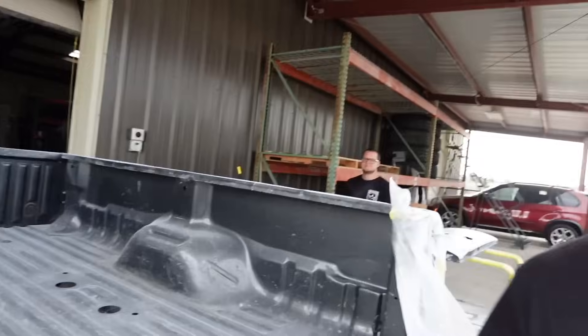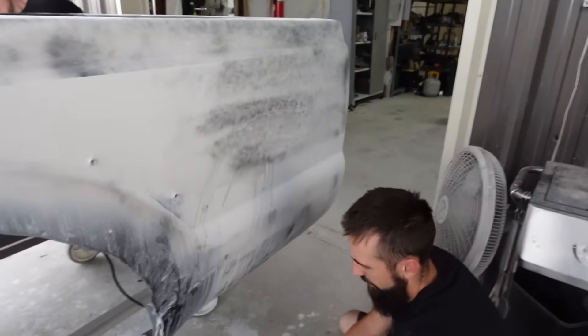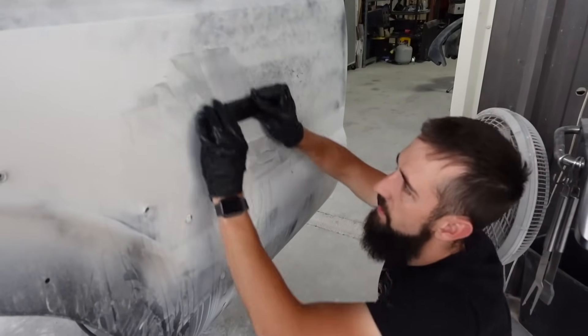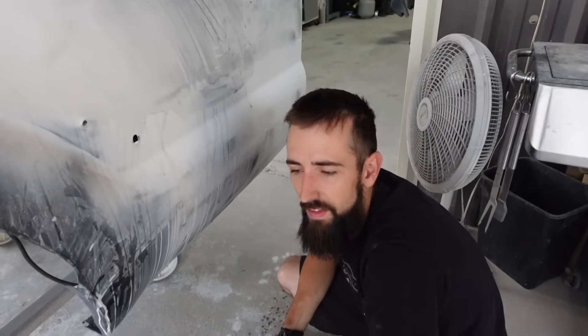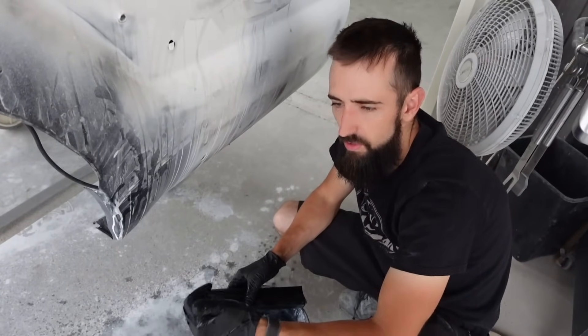It's only body stuff right now. I'm a wrencher and I'm not a body guy, but I guess I'm about to be - which I'm not against. Let's get her done. So we got some 400 grit paper and a flexi block - get it a little wet. So how do you get rid of that orange peel? You just keep sanding. Why is there orange peel? Because of the texture of the primer. Inherently all paint has some sort of orange peel - you never really lay out something perfectly glass. There are certain instances - perfect temperature, humidity, atomization - but every brand new car has a level of it.